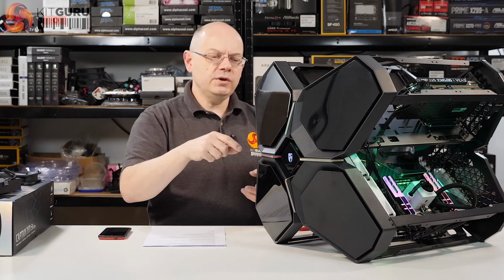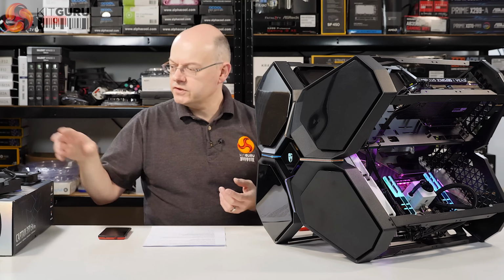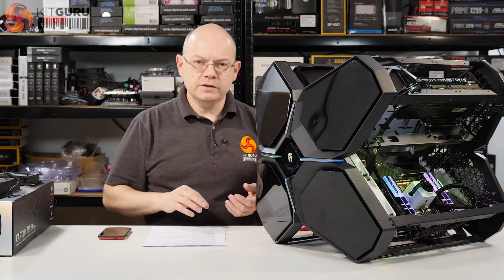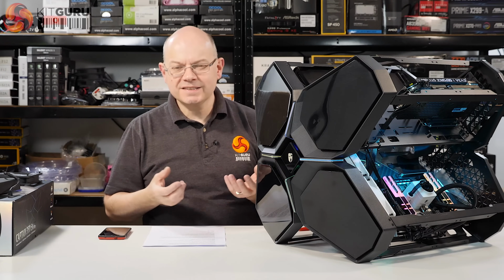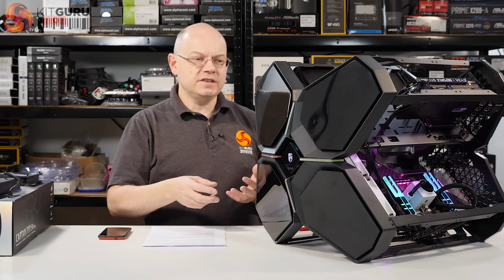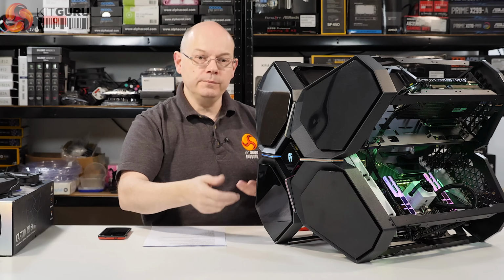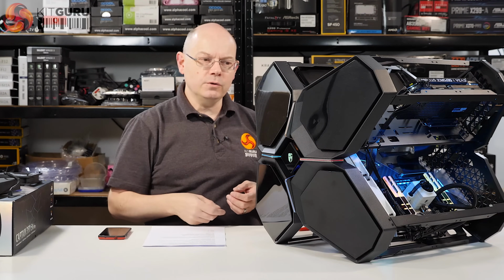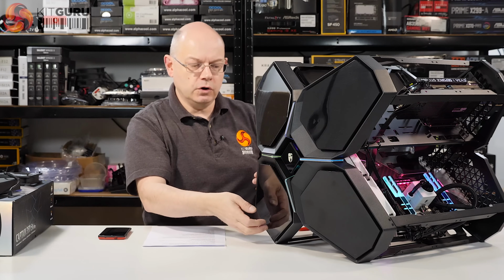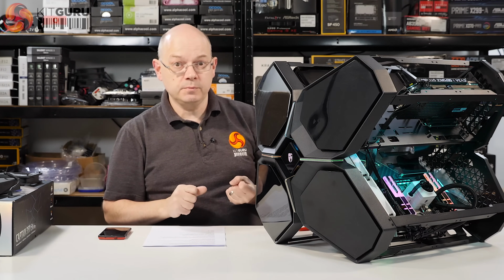Now the all-in-one cooler, you have to remove one of these sort of side brackets to give you proper access, take out one of the stock fans, thus put the cooler in place with its 3 fans, fiddle a few wires into place, it's all perfectly okay. It's not entirely straightforward in the sense that to get the cooler into place, because it's on this diagonal, you have to come in from the bottom. You can't come in from the bottom, there's a table in the way, so I ended up putting the system as a cross shape, so it's on this point here, and then sliding in from the side. But I was very careful, I was making sure it was supported at all times.